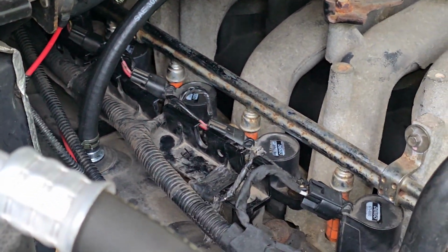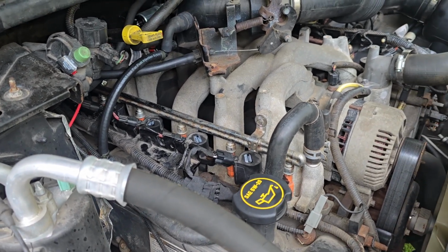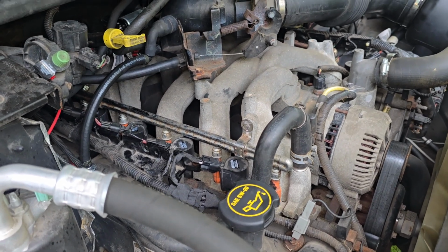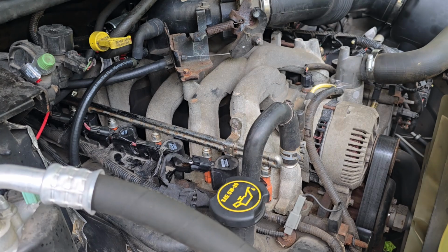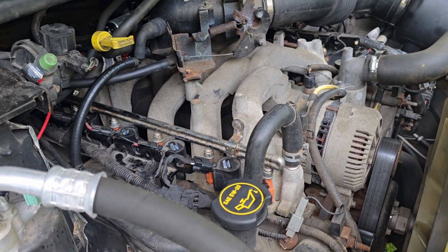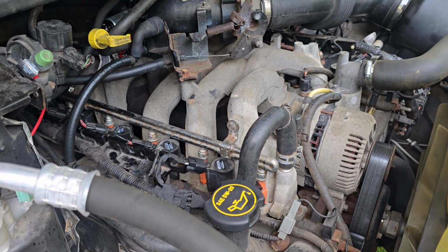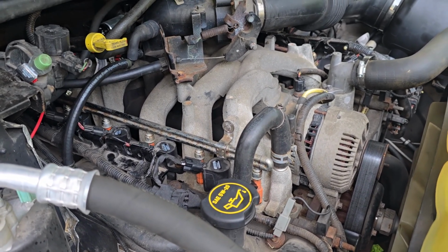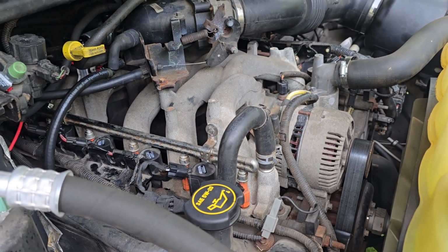And to see if it would move, obviously, and put a fresh coil in just in case it was a faulty coil. It seemed to solve it, but then it was still running really sluggish. So we ended up cutting off the catalytic converter, putting on a straight pipe temporarily for testing purposes. Looked in the cat, it was clogged. So something's eaten the cat. So not good. So I went ahead and replaced the catalytic converter.